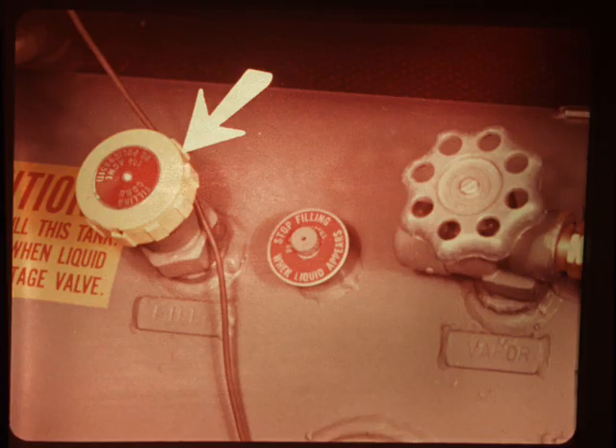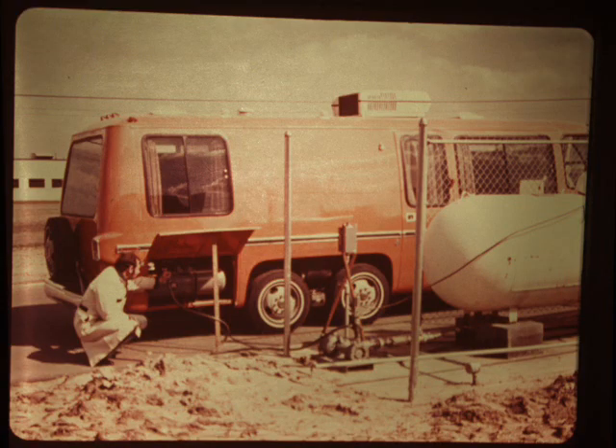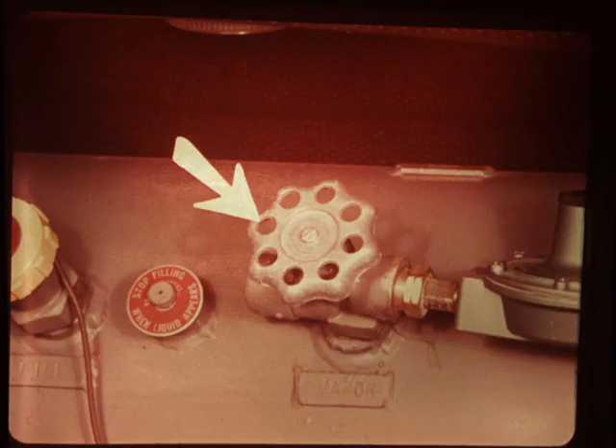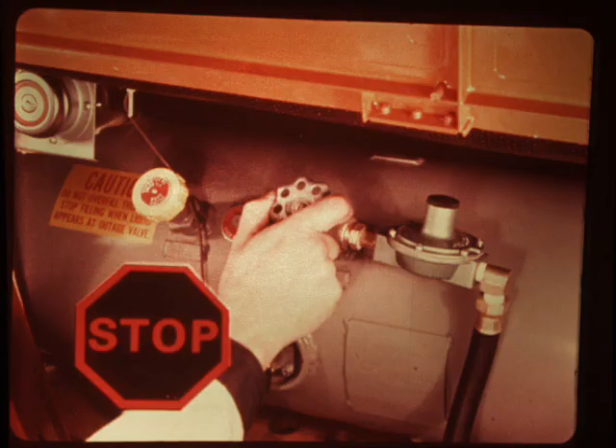This is the filling connection — you do not remove the tank to fill it. Instead, the LPG dealer storage tank hose will have a POL adapter on it, which is inserted into the motorhome LPG filling connection. When liquid appears at the 80% valve next to the filler connection, the tank is full — this valve is designed to prevent the tank from being overfilled. The next valve, the control valve, turns on or shuts off the LPG for the entire vehicle. On the line leading out of the control valve is the pressure regulator. When the appliances are not being used, such as when the vehicle is being serviced, the control valve should be shut off to prevent moisture from condensing inside the tank and to avoid leakage of LP gas. Having a small amount of methyl alcohol put in the tank when it is filled will help prevent moisture in the tank and lines from freezing in the winter.